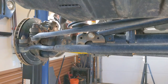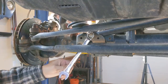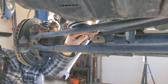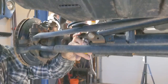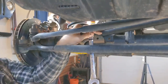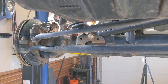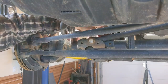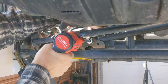Next step is to take off the track bar. This bolt right here is sometimes a pain in the butt to get off — there's a reason I call this the BFH garage. To get it started, I'll hold my wrench on and take a big hammer and pop until I can just get that bolt started. Now it'll come off the rest of the way. The nice thing is on the backside there's a flag nut, so you don't have to get a backing wrench on there.